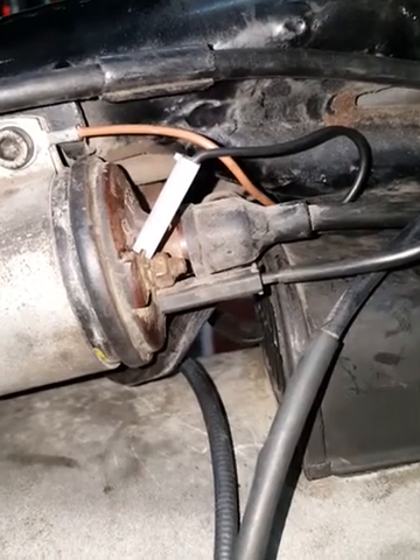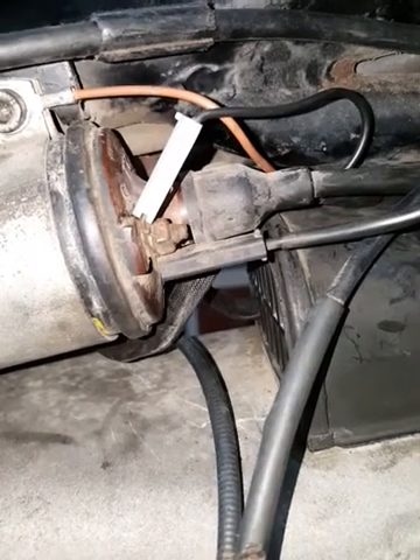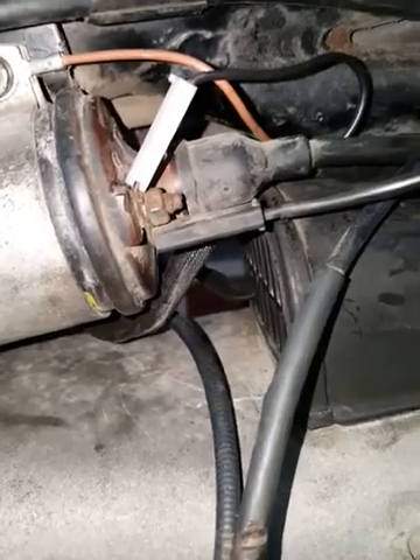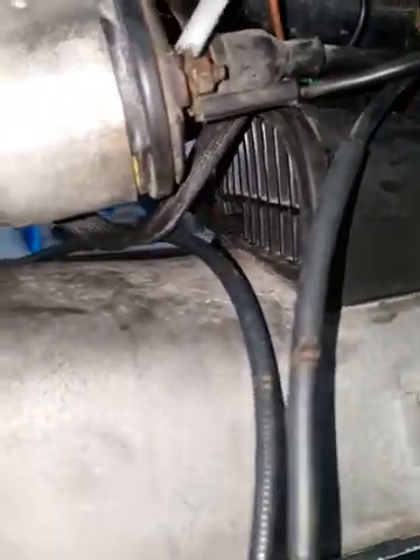I've put the black wire onto the black terminal, and on the other side the green wire is piggybacked in the same place. There's no need to take all that wiring off on these old coils because the original wiring is simply redundant in that situation.